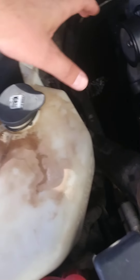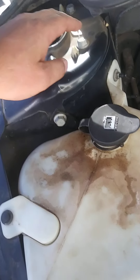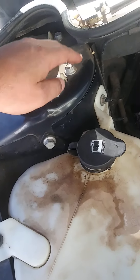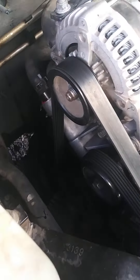Alright folks, today we're working on a 2006 Buick Lucerne. I already did the job but I'm going to explain the whole process because my phone died. This is the 3800 Series 3, but the other engines are pretty much similar — there's just a couple different parts. What we ended up having to do is replace those elbows — you see that little silver elbow there, and there's one underneath too. That orange stuff is liquid gasket. This is already the third day the car comes back to me and it's not leaking — I checked it, everything's good.